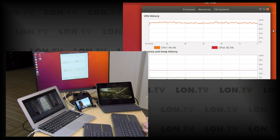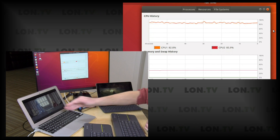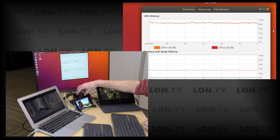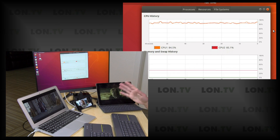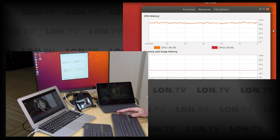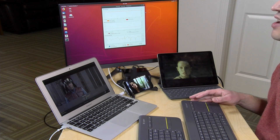You might run into a couple of little glitches as things catch up, but generally in my experience MPEG-2, MPEG-4, and H.265 all seem to be working just fine with hardware transcoding on this dual core NUC. I really wouldn't push anything else on this, because any bit of CPU usage — like loading a web browser window — might impact performance. You probably want to limit it to about three transcoding streams simultaneously, and provided nothing else hits that little dual core machine you should be fine.